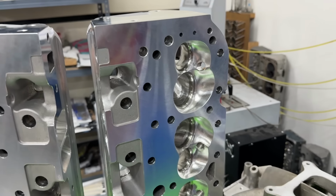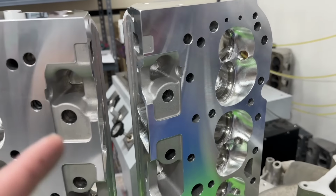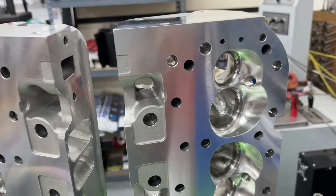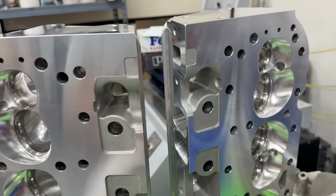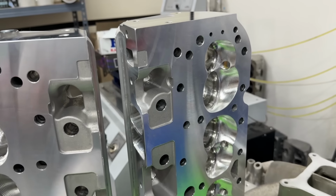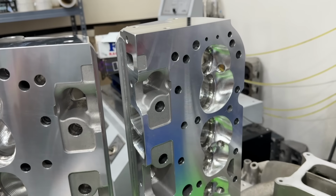And if you got a 210, you want to turn it into a 230, same thing. Do you have to run any other specialty parts to go with it? No. You could keep running your stud mount rockers that you had before with your AFR 210 or your ProMax Project X 215. But the port grows to 230 ccs. Anyway, able to do that.